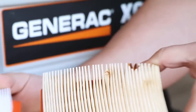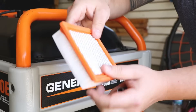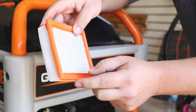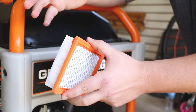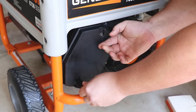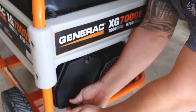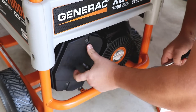You can tell between the two air filters — this one is much cleaner — so we're going to replace this. With the air filter, you're going to want to make sure that the flat side is facing you and that the gasket is sealing properly when you're placing it in. You're not going to want to force it in. Air filters are an as-needed item; your owner's manual will tell you when it's required. If it is a thread-on item, don't thread it too much as you might cross-thread it or strip the plastic threads.